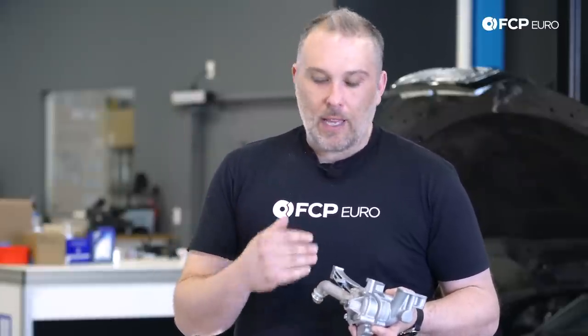And when you're talking about high RPM changes constantly all the time, any kind of slack in that chain essentially acts like an impact on this, and it could cause the nut to come loose. Because the chain is tensioned, that's not so much of a problem.